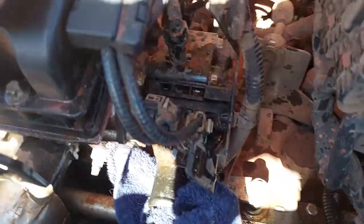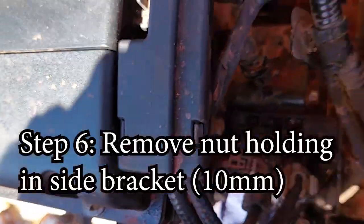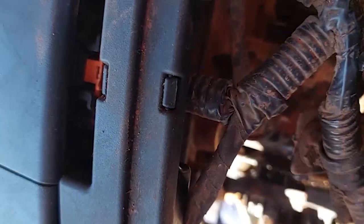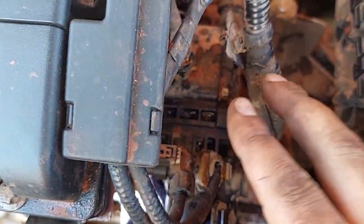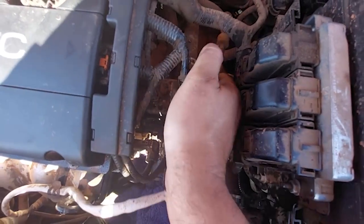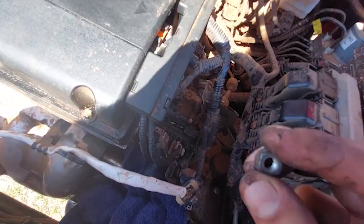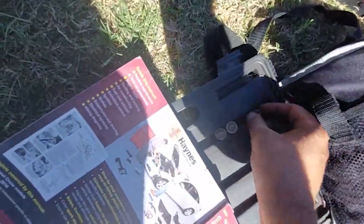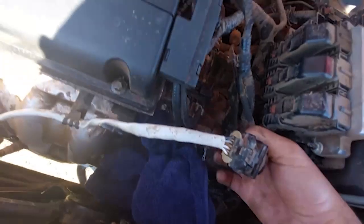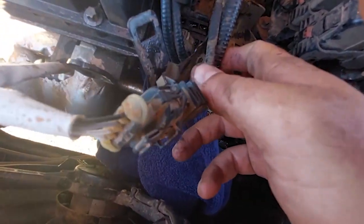Now I'm going to move the oxygen sensor out of the way. There's a little clip on the back of it right here — push that down and it should pop out. Just move it out of the way; it's flexible so we can move it and have some room to work down in here. This is where our job is. There's a black bracket on the right-hand side with a bolt — it's too hard to get to by hand — and that's the thermostat area. I'll remove that 10 millimeter bolt from the bracket.